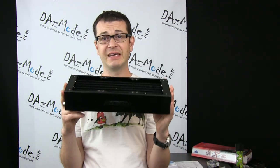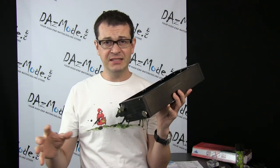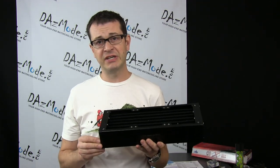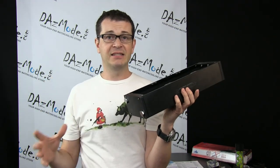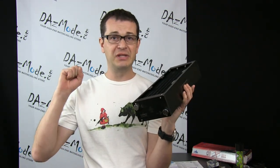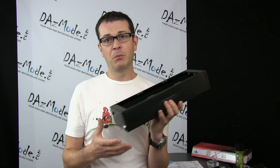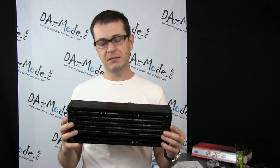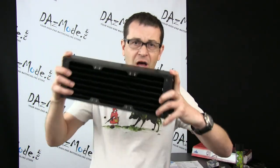Another difference — back to tubes again because it's the main thing here — is that another nuisance is going into history with these radiators. When they're produced, they are laser-welded by an automatic machine and after that cleaned in an ultrasound bath. So there's no debris whatsoever inside those tubes. Not only do you not need any flux to produce them, unlike copper radiators, they also clean them. This means you can do a really light flush with distilled water and just install it — no more voodoo magic where you fill the rad with hot water, run vinegar through it, and shake the heck out of your radiator. That's gone, which is good news.